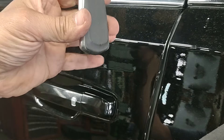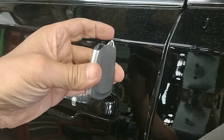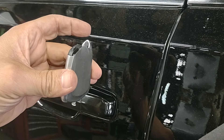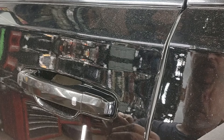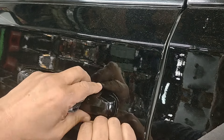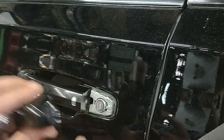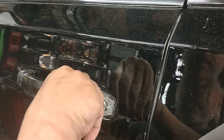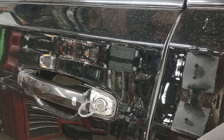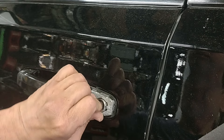Now when you unlock the door, the alarm will go off as soon as you open it. Just go find the slot — it's in the middle console. You slide it in and start the car and the alarm will reset. There's a slot behind this cover; you go inside and this cover will come off, and here is the cylinder.